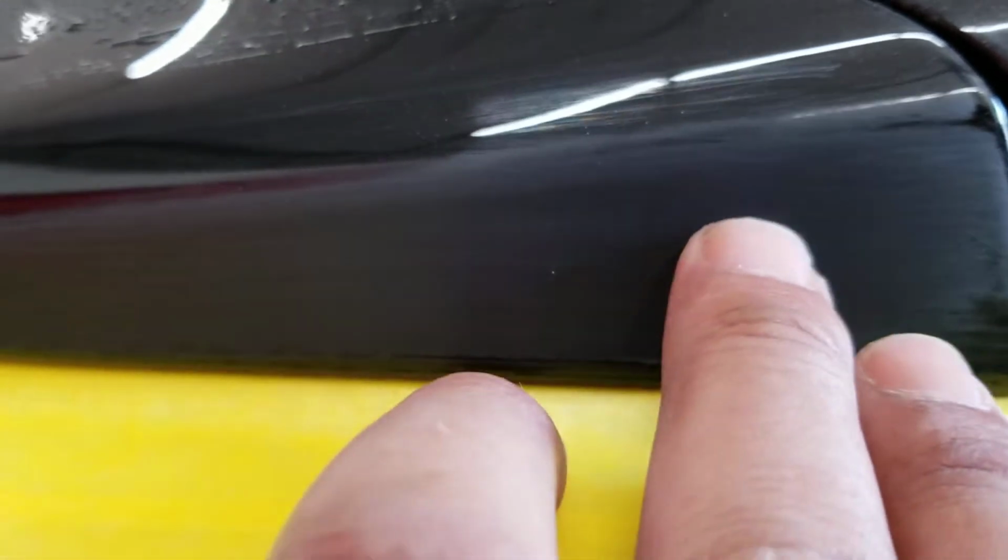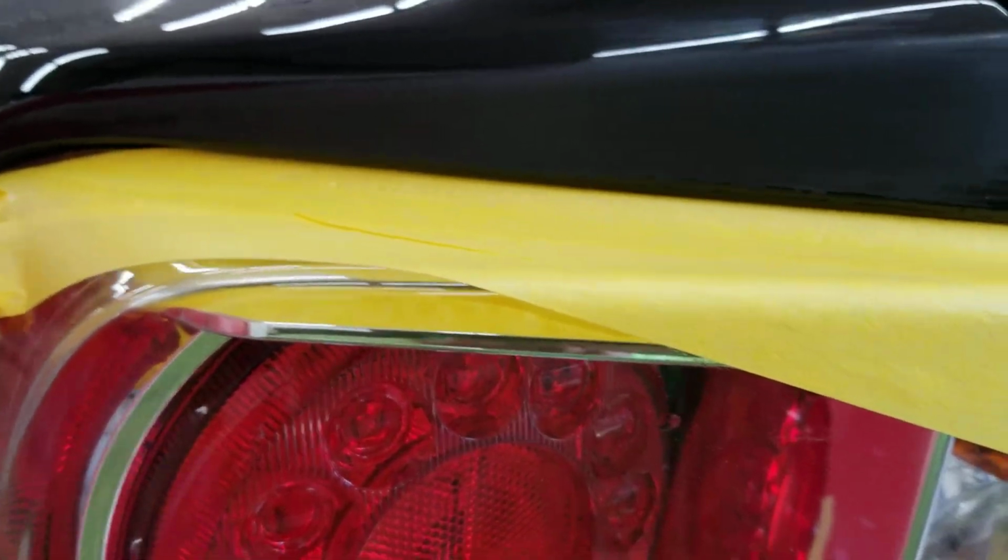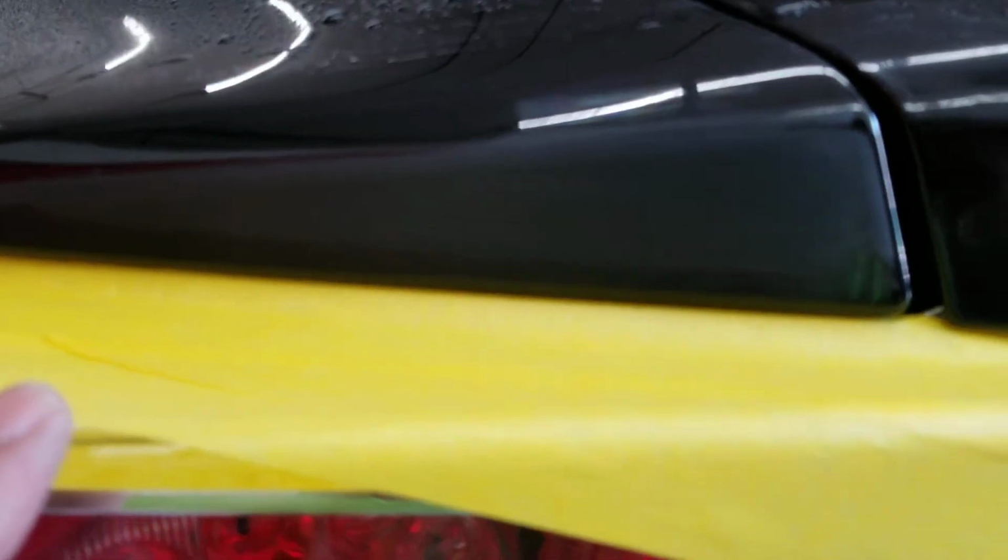When I wipe it, just let it dry so you can see if you missed anything. So I blow on it a little. You blow on it a little, it'll just dry almost instantly. If the run was still there, you'd see it within this area. So now I just gotta run through with my little polisher, and this half is done. Now it's gonna be the rest of the car. I gotta go through every inch that was painted, look for runs, look for any imperfections that I would have to focus on. So yeah, let me go get my little polisher and get that set up.